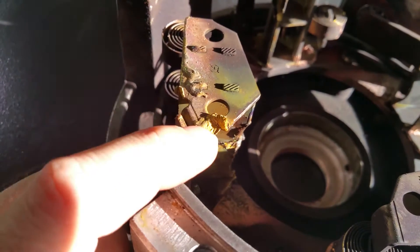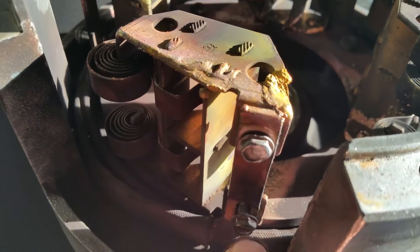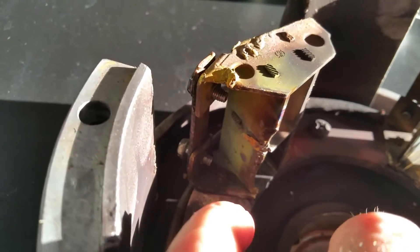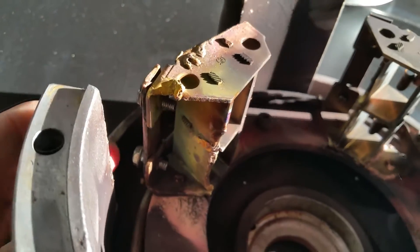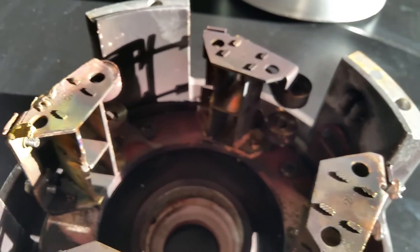The current obviously arced from here — there's a field coil right about here in close proximity. It's also interesting to see the amount of melting that happened across here. You can see that metal bolt there is actually melted through. Looking at the interior, you can see how much that's eroded away. I checked inside the case and there's no sign of arcing anywhere other than the field coils and maybe the actual cast-iron housing. The cover and seal show no sign of any arcing — other than being covered with carbon dust, they're in great shape.